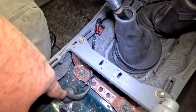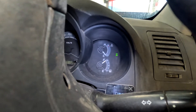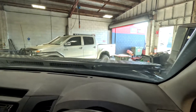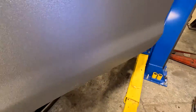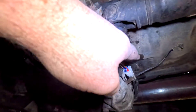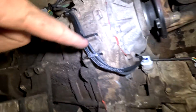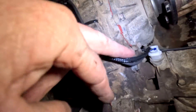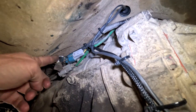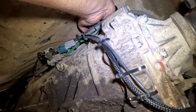The wiring comes along, drops through the cabin underneath right here where we do them. There's my next one to do. I'm a little bigger so I can just slip under here because these things are lifted. We've got this plug here — I need to replace that one. There's the four-wheel drive light. I've tapped it into that one there, so that's going through the factory loom on this vehicle. My loom plugs into the low-four switch.